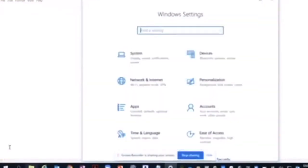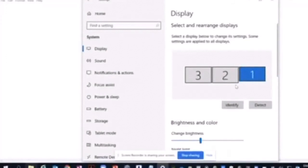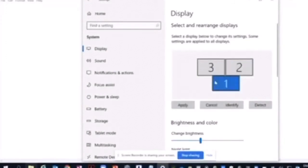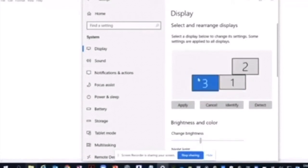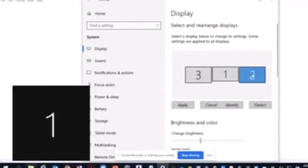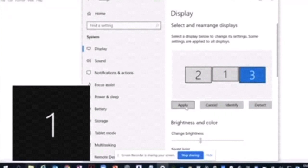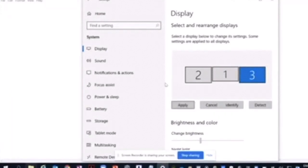To configure your display for a Windows laptop, click the Start icon, then Settings, go to System and click on Display. This window will allow you to arrange your screens in the correct order. First, click the Identify button — this will show you what screen 1, 2, and 3 are on your laptop. Next, drag the screens so your primary screen is in the middle, the left screen is on the left, and the right screen is on the right. Click Identify again. If done incorrectly, you may need to swap screens 2 and 3 until the physical screens match the arrangement in the display settings window. Click Apply and you're all set.